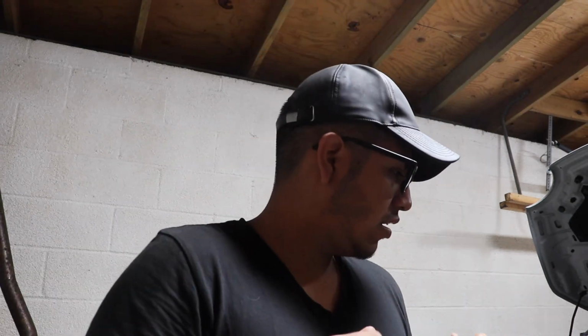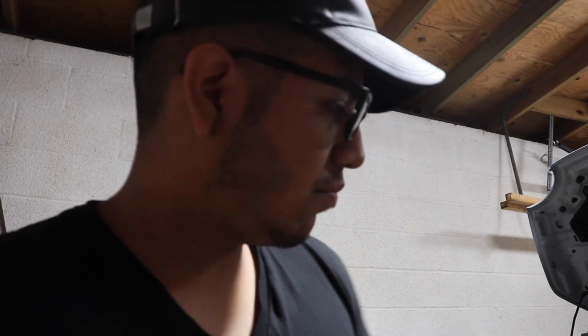Good beautiful morning. It's your boy Alex Rowe Media, and I'm gonna go ahead and continue on with the big turbo. So I left off with unbolting the banjo bolts for the oil feed line, coolant line, and the oil return line. So I went ahead and took those off, and now I'm pretty much up to the point where I have to take off the downpipe. Let me go ahead and show you guys.